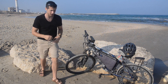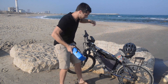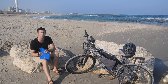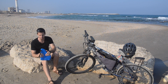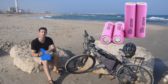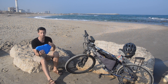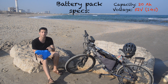I'll start by showing you guys the battery I made for this bike. I'm not going to go through all the steps of making the battery — I've got a few more videos on my channel where you can see all the how-to steps for building your own lithium battery, I'll put a link up here. But basically, this is a battery I built a while back out of Samsung 26F cells, which are pretty economical — good quality but cheap cells. They're 2600 milliamp hours, or 2.6 amp hours each, and they can handle about 5 amps each. This battery is fairly large — it's a 20 amp hour battery, and it's also 52 volts, which means it's 14S or 14 cells in series.